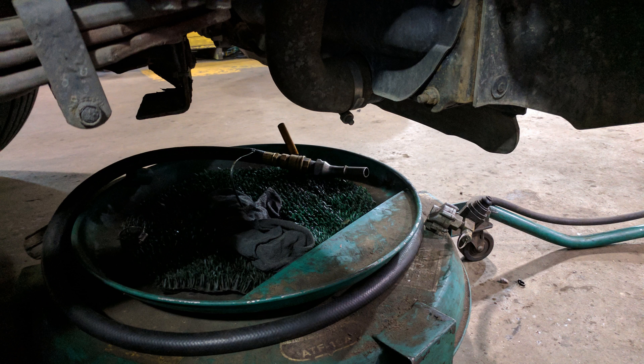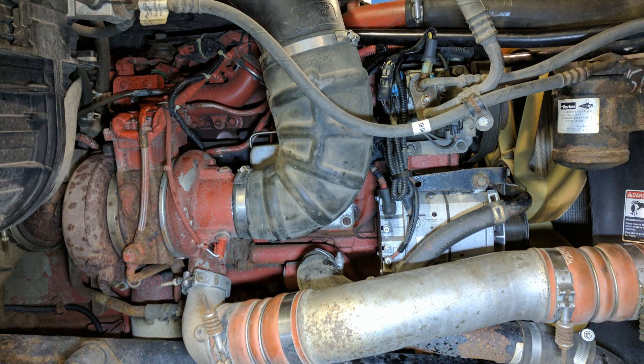It's a good time to start draining the coolant out of the engine. On the Cascadia, the drain is at the bottom of the radiator. A one-inch socket will loosen it off.